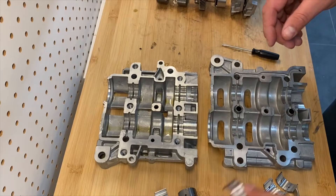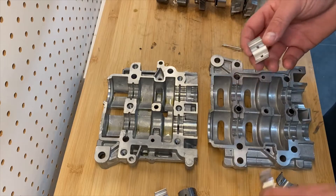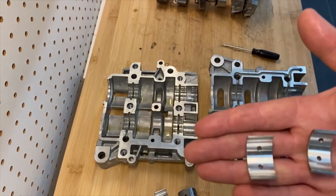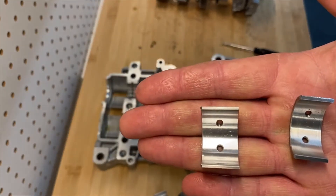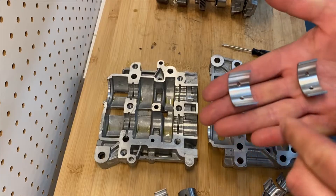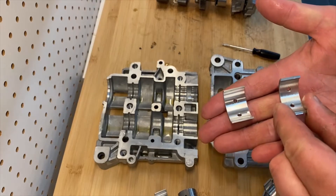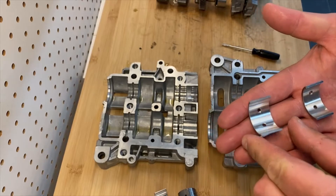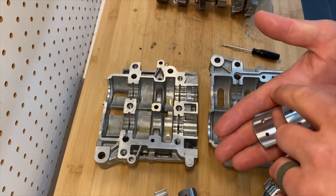When you're rebuilding this balance shaft, there are two options of bearings. As you can see, one is wider than the other version — the wider one is for newer balance shafts, the narrower one is for the older version. We have descriptions on our website where you can see the different types of balance shafts to know which type you need to order.